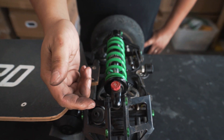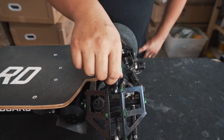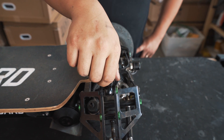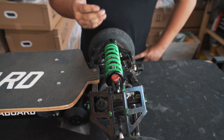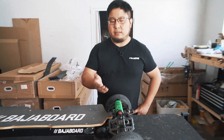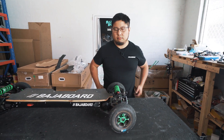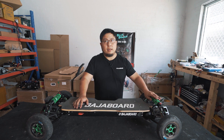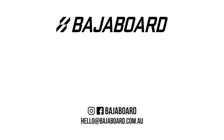Ideally, our recommended setup is to turn the rebound adjuster all the way anti-clockwise to the fast position, then go back five clicks, and leave it there. You are free to experiment with this and find whatever setting you like — you can also set the front and back at different settings. Now that you've successfully set up the shock absorber, we can look at adjusting the toe angle and the camber of the wheel, which we'll link in the description below.